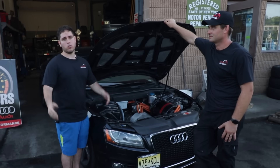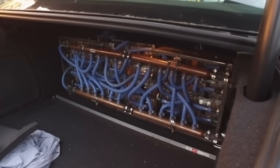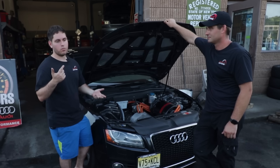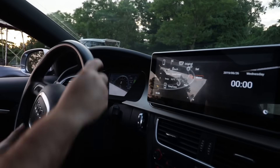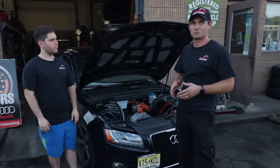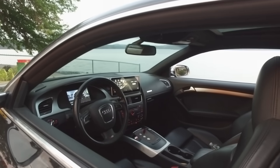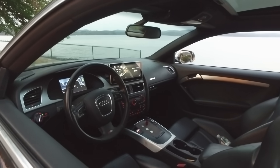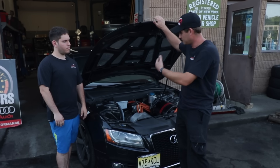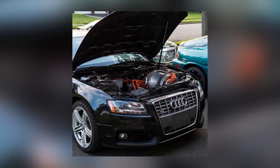It's getting information from all different places. The BMS — battery management system — tells you things like your battery's voltage, temperature, all that kind of stuff, which is what you'd see on the display. All the CAN bus IDs and what they're communicating on the CAN bus network let you reprogram Audi's original modules to actually work together with the Tesla drivetrain.